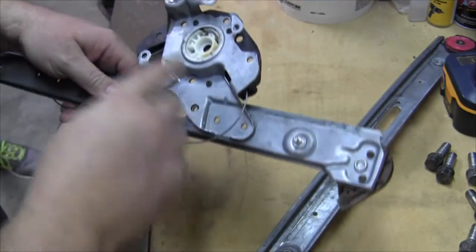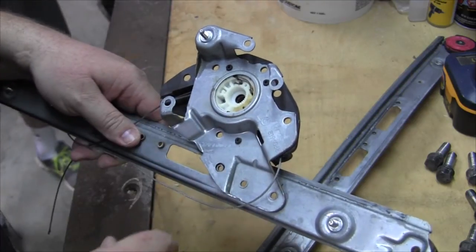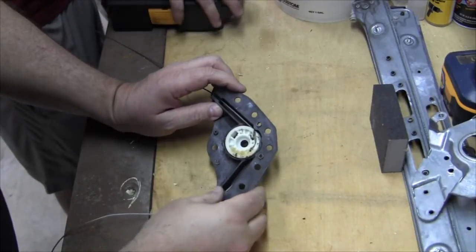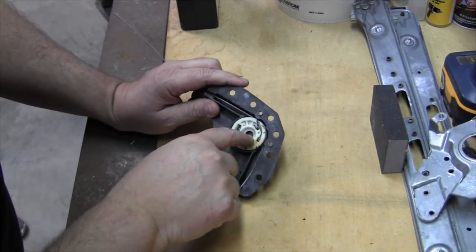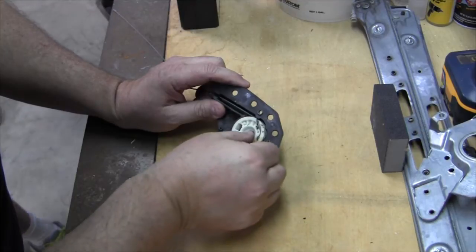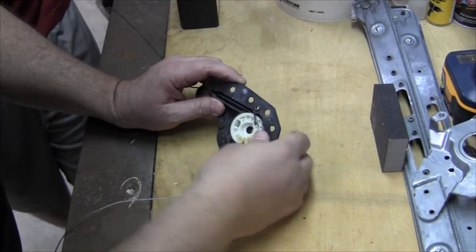We're still going to take this apart. I want to see how this grabs that cable. In fact, there it is right there. I just want to see how that looks. Let me do some drilling, just so we can see how this thing comes apart. The motor has got a plastic wheel. These are those teeth that we saw were pretty good, and they're in great shape. And then this is the wind up wheel. This winds up and makes this cable go in or out. But I'm gonna try and pull that off.